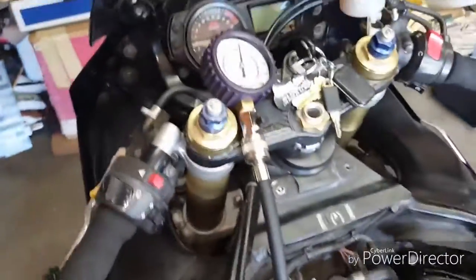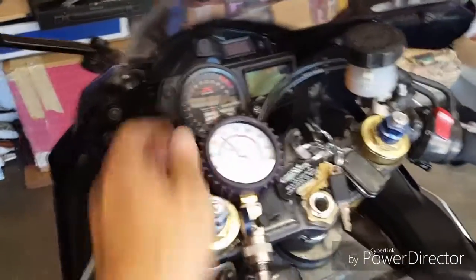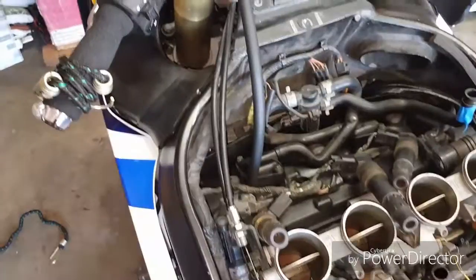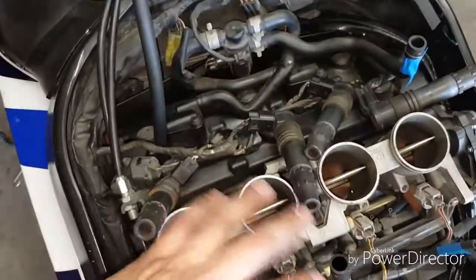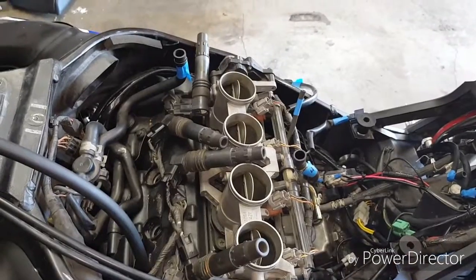That's the compression test right there — we're looking at a little bit under 160. So cylinder one or four — the book says this is one, but some people go four, three, two, one. Either way, we're almost at 160 on this side, so we're looking pretty good. That's a quick overview on how to do a compression test. Make sure you remove all the spark plugs first before you do it. You don't want to leave the cylinder exposed or get anything down in there. There's a quick tutorial on how to do a compression test on your 04/05 Gixxer — as always, see you next time.